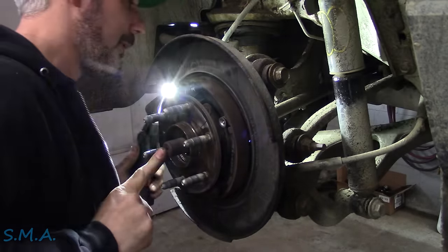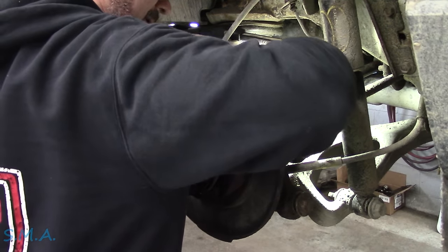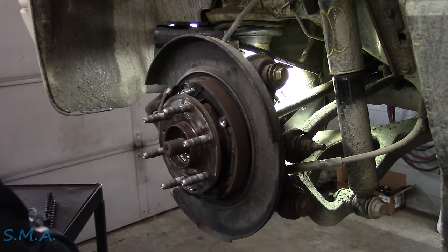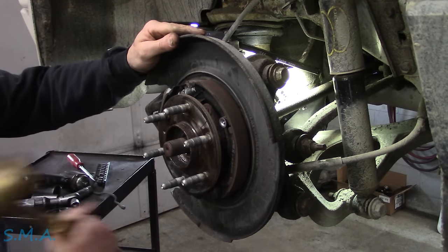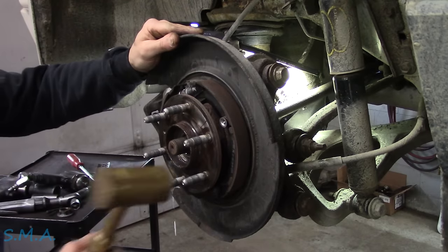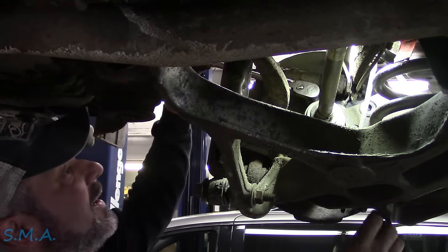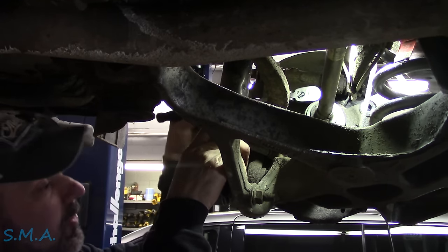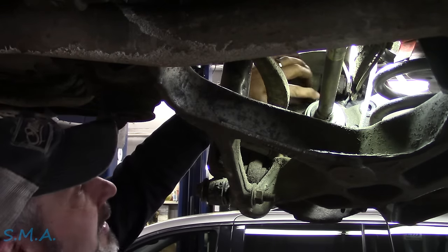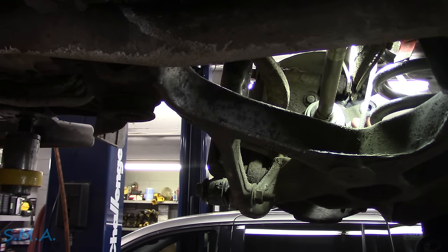We're going to see if we can beat the axle loose, make sure that's loose before we get too far, then go back on the back side. I need to steal some sockets — they feel like 18s, not 21s. Let's get this moving first. She moves now baby. Looks like there are three bolts back there, yeah, they are 18mm. Got one cracked loose. The other ones are kind of tricky to record so you have to use your imagination station for a minute.